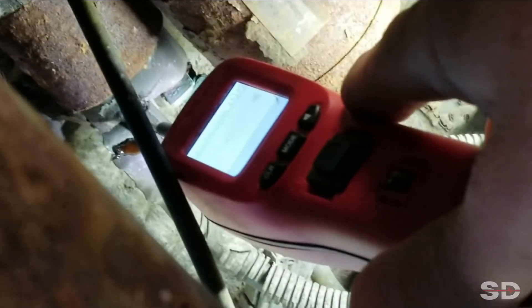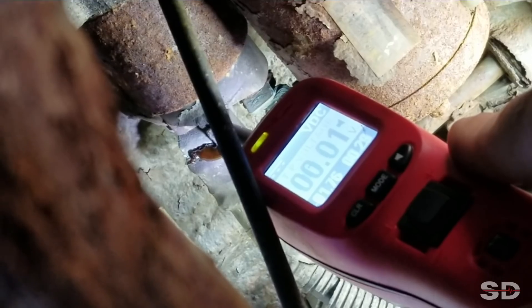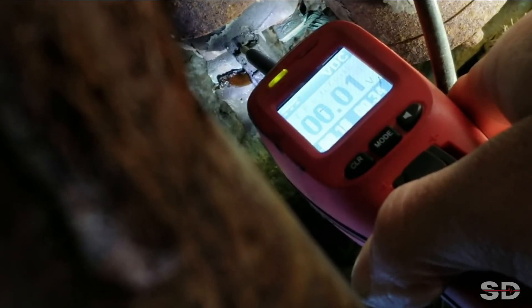Maybe it ain't the starter, huh? Might not be, Pete. Might just be this connector right here. I got nothing on that terminal. Let me go after the big one here. Crank it. See voltage staying steady on the big wire — no issue there. Smaller wire showing a ground initially, which it should — crank it. Okay, I got nothing there, and I saw smoke. So what that means is this connector is bad right here. Resistance equals heat, guys — I've said that so many times.